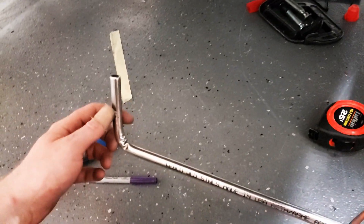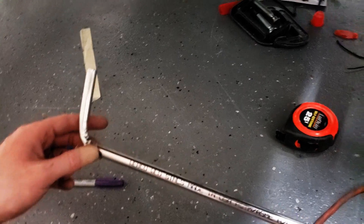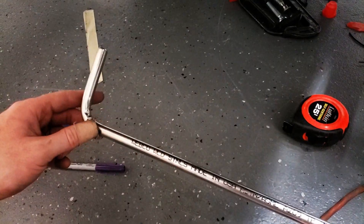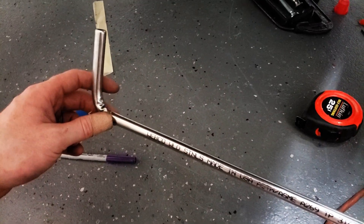What I'm going to try next is filling the tubing with sand. That's actually a technique — plug the end and see if I can get it to bend without flattening out with sand inside.